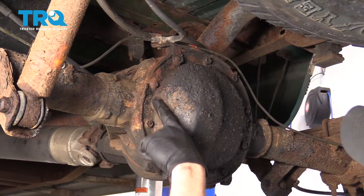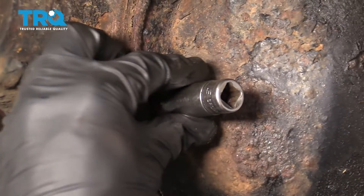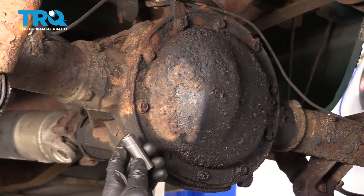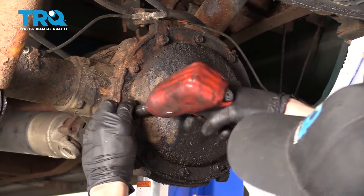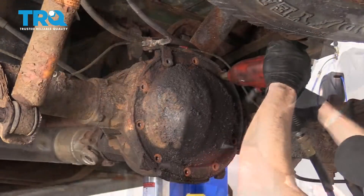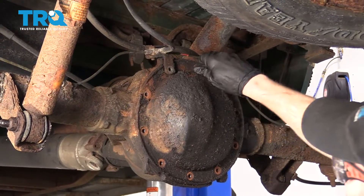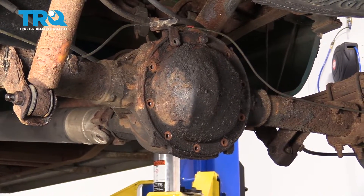Take a look at all these bolts and see if they look like they're rusted and rotted. You might need to just put your socket on, give it a couple taps, and that should break away the majority of the rust. Once you've done that, continue on with your 13-millimeter socket and remove all these bolts. Just take one of those little bolts and start it in there a few good threads. Next thing we're gonna do is break this pan free — of course, fluid's gonna come out, so make sure you have your collection bucket.